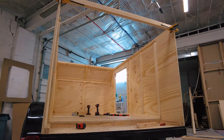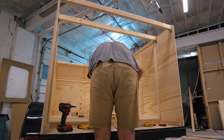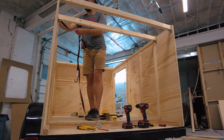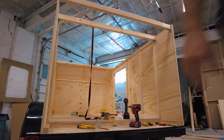The next step was to add my roof supports. I cut these supports and then used a ratchet strap to straighten the walls while I screwed them in. The roof supports are 1x2s, except for the back cargo space where I went ahead and used 2x3 lumber for extra strength. The 2x3s are also attached with the metal brackets that I showed earlier.